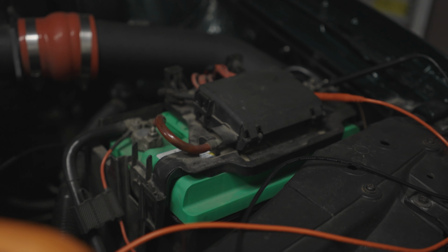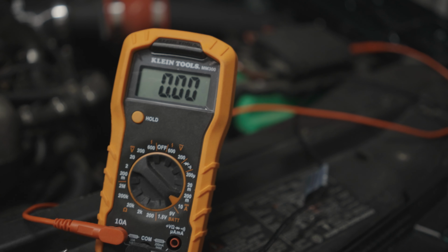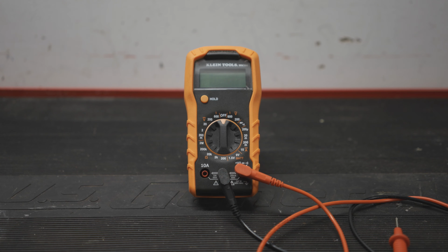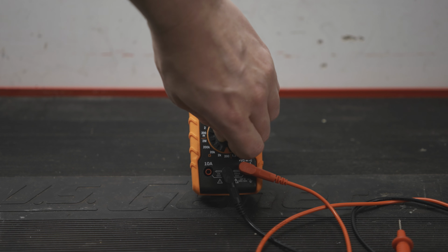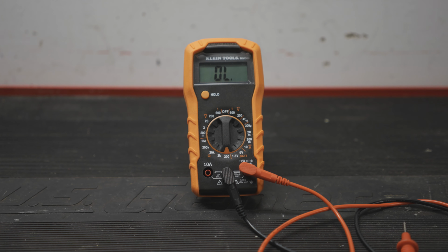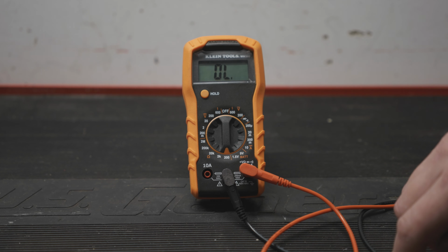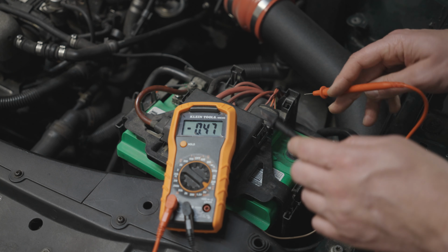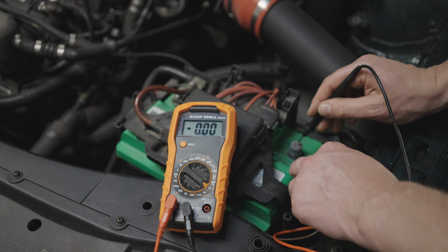Except if you see a reading of zero. First try changing your scale. If you still have zero, check your leads or the multimeter itself. You could have a damaged meter or a blown fuse. If you do suspect a blown fuse, check out a video that I made here, I have an easy way to diagnose it. Lastly, if you have a negative number, you can switch the leads to make it positive, but that negative doesn't matter, it'll be the same value either way.